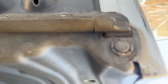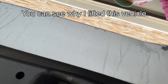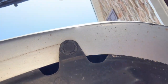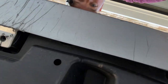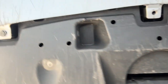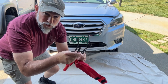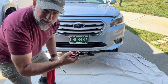The next thing I'm going to do is remove these clips that go all the way around. Oh, that one's missing. So is that one. These clips are right here. They have to come off first, as you can see — all of those. The ones that are missing, I'm going to go ahead and replace those when I put the bumper back on. I'm going to be using these tools here to pry off some of these clips, and they come in handy because they're made of metal and they don't get as much flex.